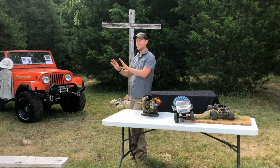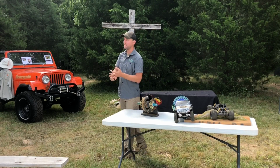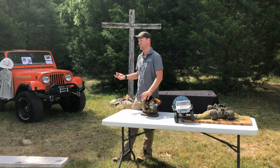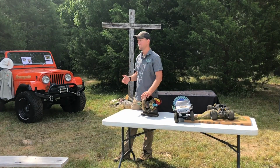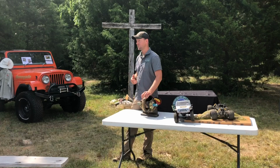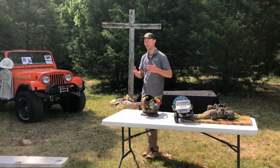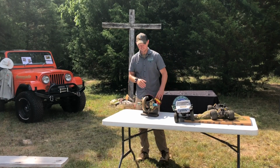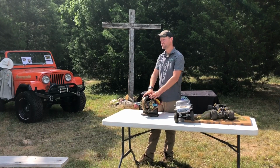But if we stall and we start again just using the clutchless start, the only two items we're wearing out is a battery and a starter. Okay, super easy to replace a battery off-road. And with a manual, we can just push start it. Starter, same thing. We can push start it, or we can replace a starter off-road. Replace a clutch, we're doing a whole lot more. So that's kind of the thought process behind forgetting that clutch exists. So that's how we overcome the differential with that 2-foot driving.